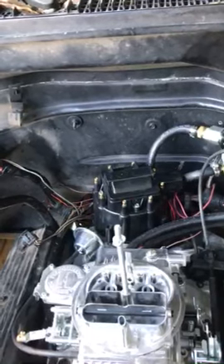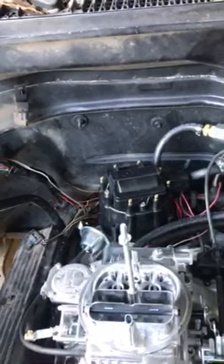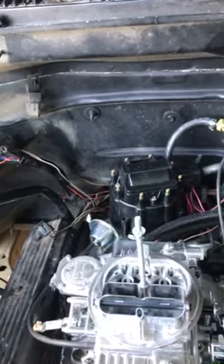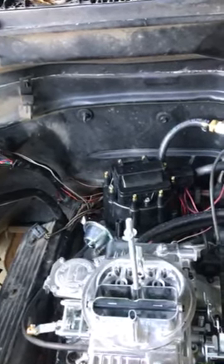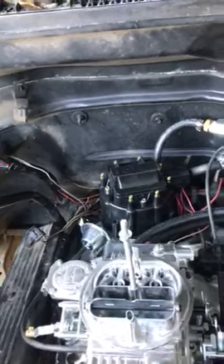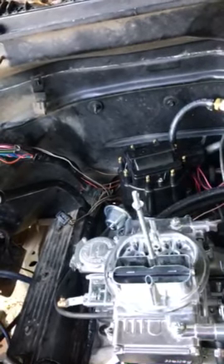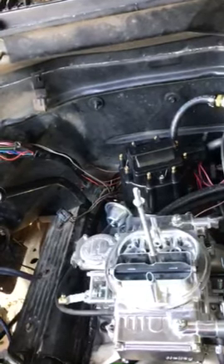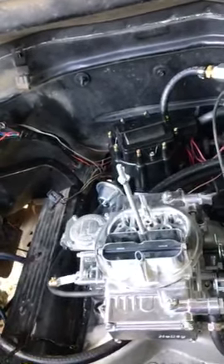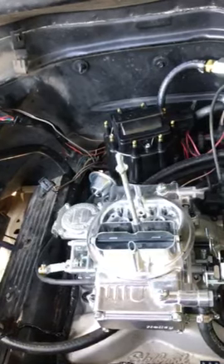Fuel injection is a lot more dependable these days, but this was the infancy of production-line fuel injection. It worked well for a while, but they're getting age on them. One little worn wiring harness can drive you nuts and be nearly impossible to find. On an old truck like this used for hunting and around the farm, a carburetor and old HEI distributor will do just fine. You'll have plenty of power, it'll run smooth, it'll idle smooth — none of that chasing idle with the computer adjusting ignition and fuel mixture. If you have any questions, leave comments below — I'd be glad to answer them. Thank you for watching.